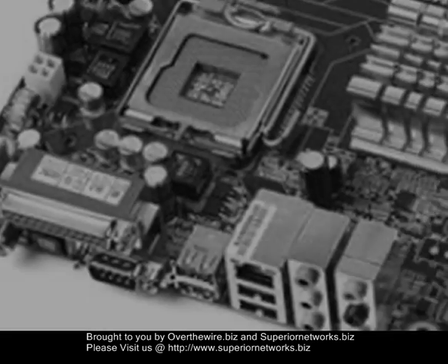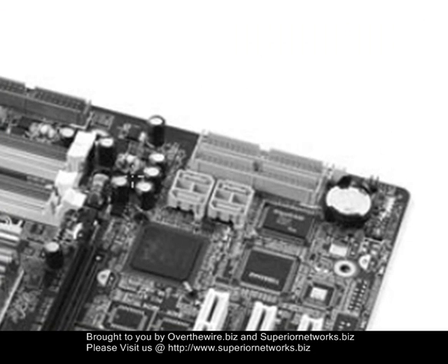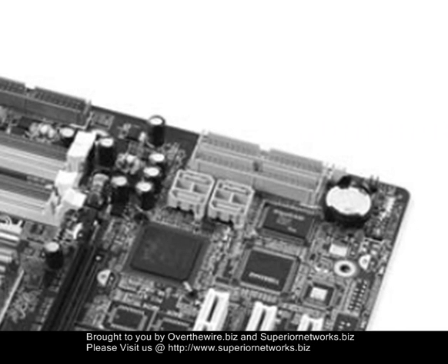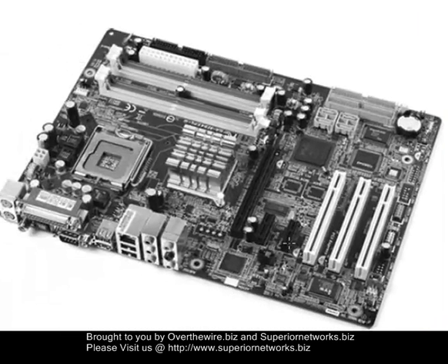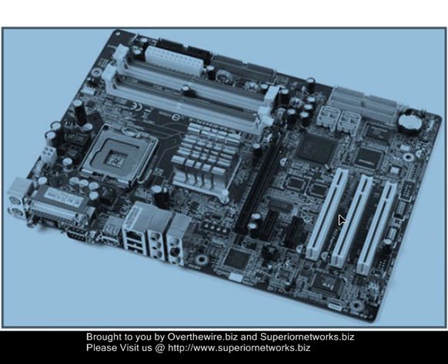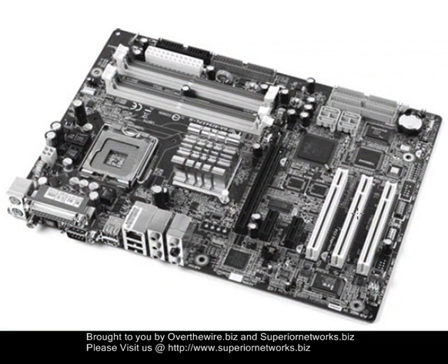You have all these other little things in here — these are resistors. You'll never have to mess with one unless one breaks off, which I've never seen happen. This does look like it may require a jumper, but nowadays they make boards called jumperless motherboards. There are a couple other slots — these little ones right here can be used for modems. The terminology behind these is called expansion slots. This is an AGP expansion slot; these are PCI expansion slots. The PCI card, AGP, and there are different architectures out there for modems.